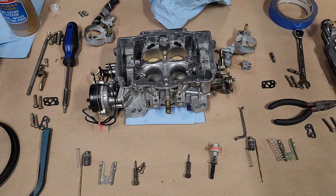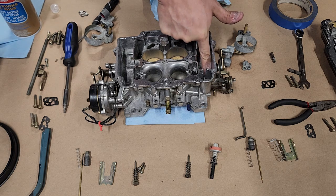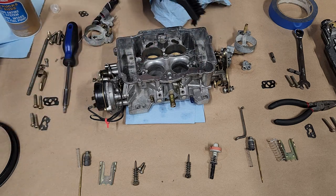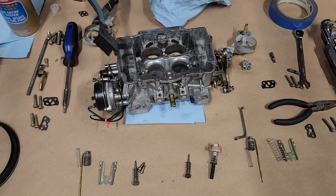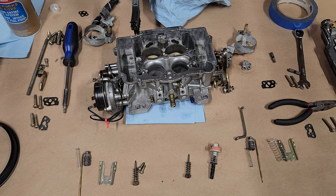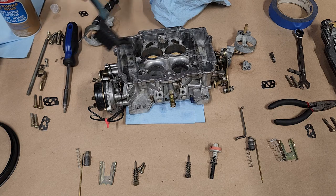Give everything a quick wipe down. There's a bit of corrosion on the aluminum body, so you can get your scrub brush and get in there. At some point there's a coating on the inside, but ethanol and fuel eat away at that coating - especially if you let ethanol gel live in there for any amount of time, it just destroys it. You're never really going to get it looking perfectly shiny like when it was new, so that's a one-time thing.